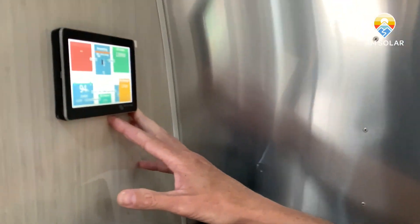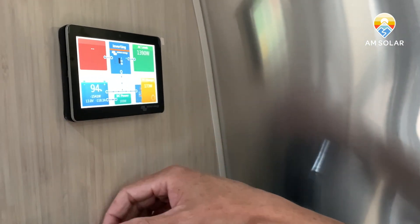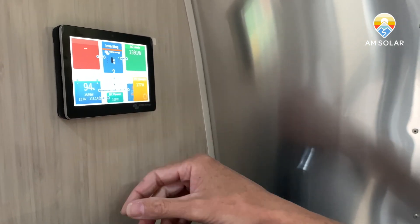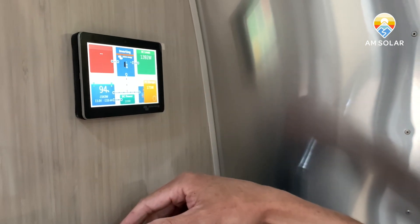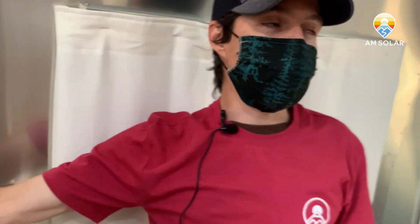You'd probably need about 2000 to 2500 watts of solar in real time to offset an air conditioner, and that has to do with inefficiencies in how power flows. It can be done, but it's not common — that's why when you're boondocking you have a limited time and duration to run heavy loads. At this system size, solar will replenish roughly 50 to 100 amp-hours of battery capacity per day, whereas the air conditioner pulls at least that much out in an hour.